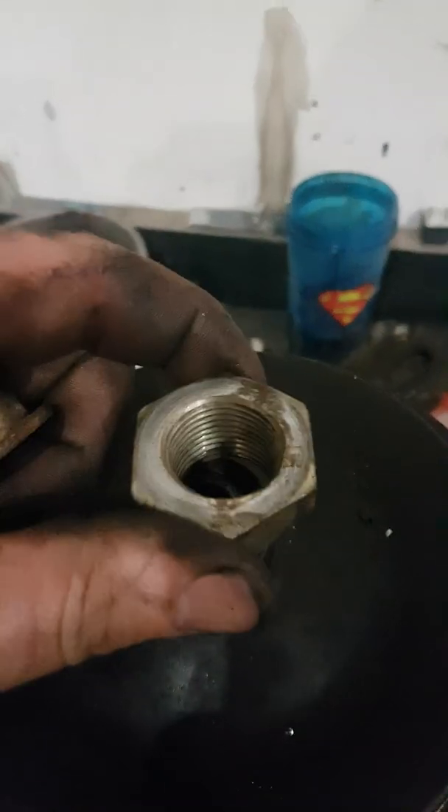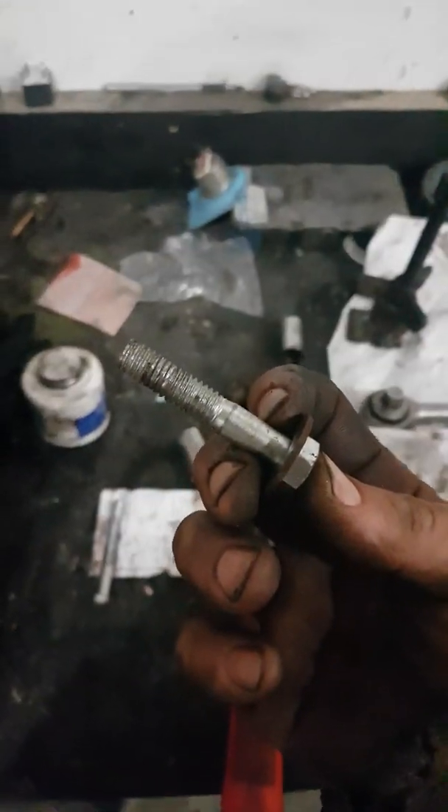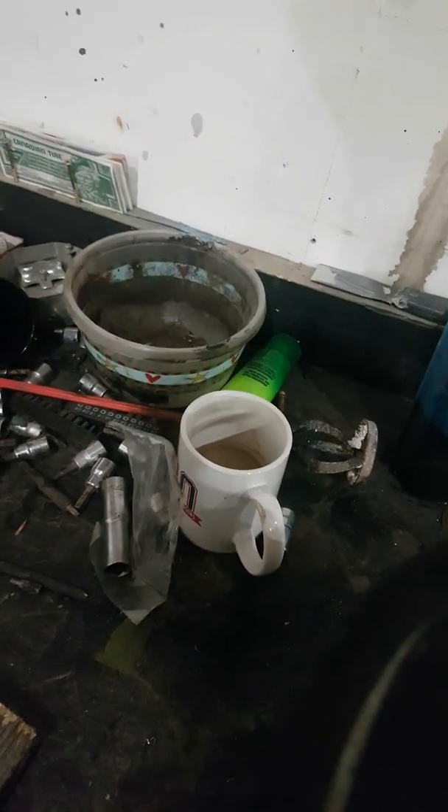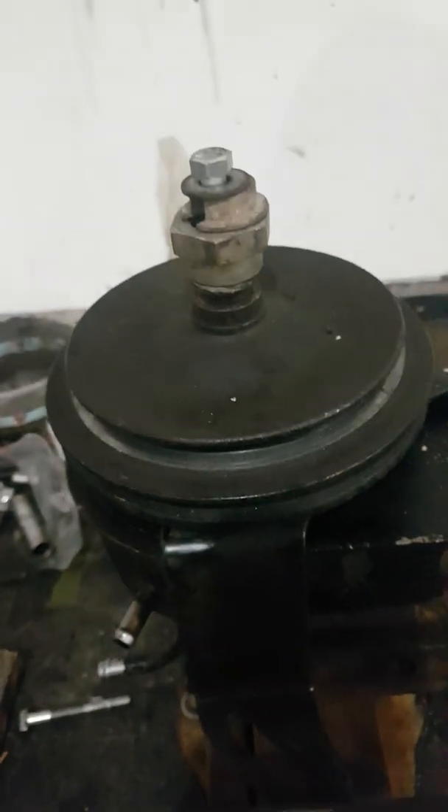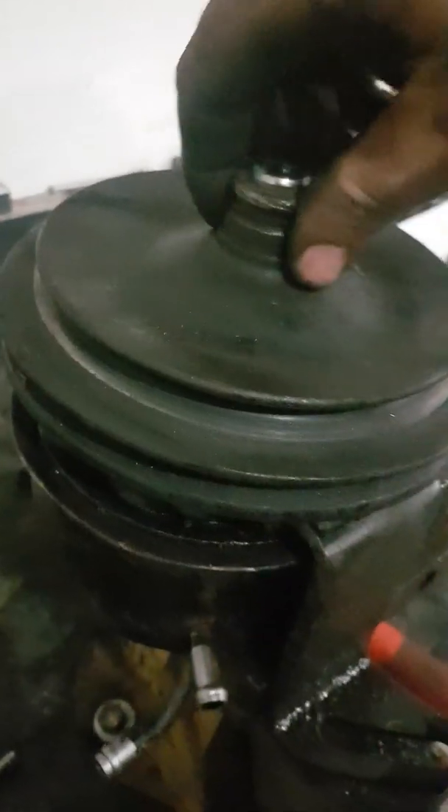I got this big nut that fits nicely — set that down on top. I got this bolt here that threads in. Basically I'm going to take the ratchet and squeeze down on that and make sure it's sitting where it needs to be — and that'll be that. As you can see it's not flush anymore; just put it down a little bit further. But make sure you don't go too far, because if you push it down too far this here won't turn — you get binded up inside.